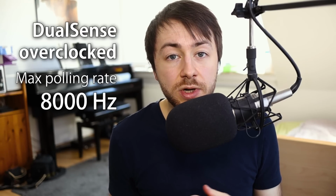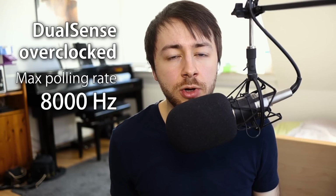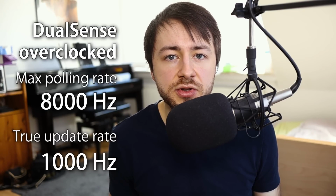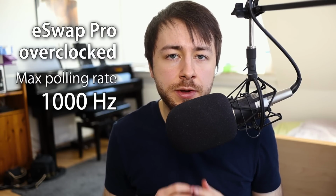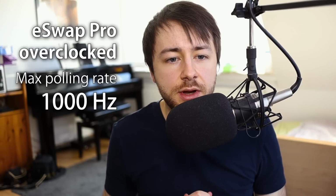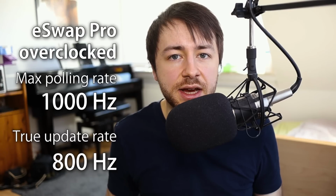Even though the DualSense will send up to 8000 reports back, the analog stick value will always repeat 8 times. Thus, the true update rate is 1000 Hz. The Thrustmaster eSwap Pro will overclock to 1000 Hz, but will only have around 940 reports, and the analog stick will only be providing 800 unique locations a second.